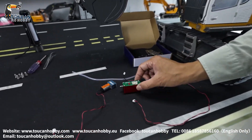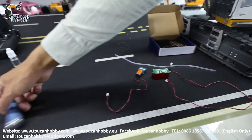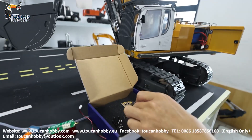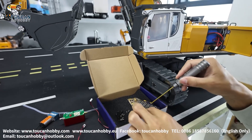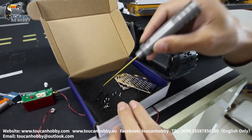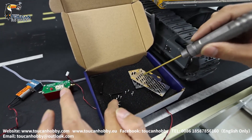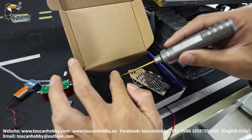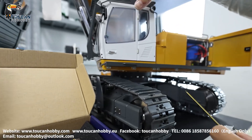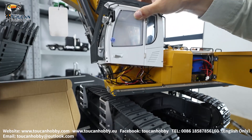Here is the heating unit, this is the motor, connecting wires, and the hose. For the cabin, I already took it out. Under there we have two plates we have to first remove. Before removing, you will see at the front there are two screws you can already take out. After removing these two plates, you will see one more screw at the rear side. So totally three screws are holding the cabin. After removing them you will be able to take out the cabin.